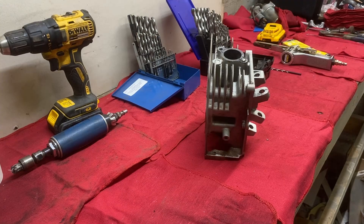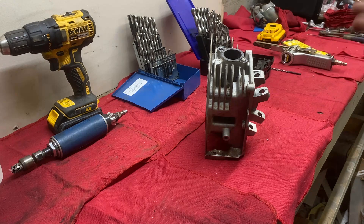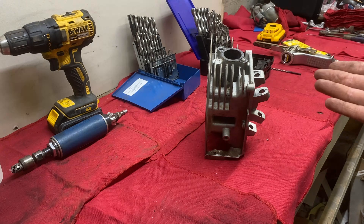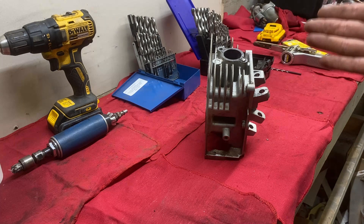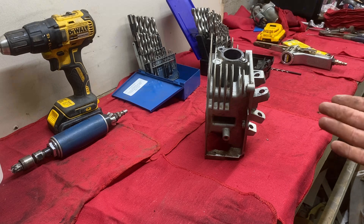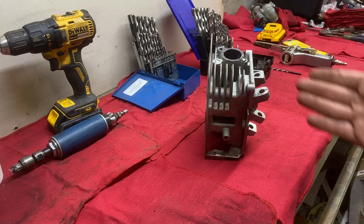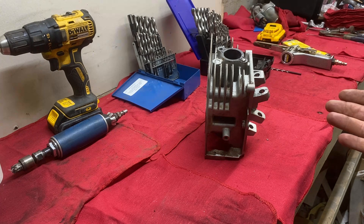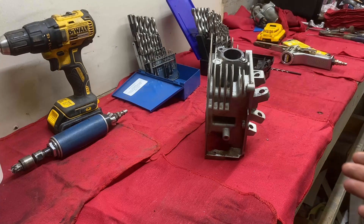I did try to weld a nut to this exhaust stud — it's acting almost like it's cross-threaded, trying to pull the threads out of the aluminum. I cannot drill it and put an easy-out through it; it will not come out without breaking the easy-out. I had a nut welded on very good and it just broke the stud further down before it even attempted to remove it. I put heat to it, tried penetrating oil — the only solution is to drill it and tap it, or drill it and put a helicoil in. You might be wondering if this is even worth doing — you can pick up CNC-ported 420cc cylinder heads online all day long, but they come at a heavy price. I'm wondering if I can fix this head and save myself the money with just a little elbow grease.